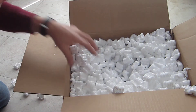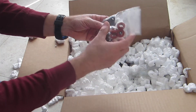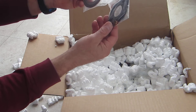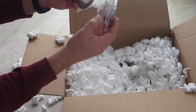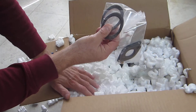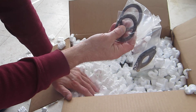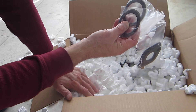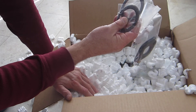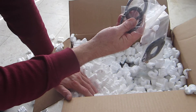Let me get some peanuts out of the way. Looks like some oil cooler seals, and then some carburetor gaskets, and some flywheel shims. The flywheel shims are going to help me set the end play — the axial movement of the crankshaft — in my 2332 so that it's not excessively loose nor excessively tight. I'll do another video installment on the block and test fitting everything, where I'll hopefully demonstrate setting the end play.